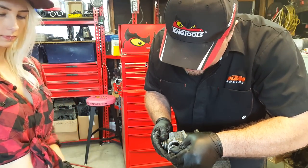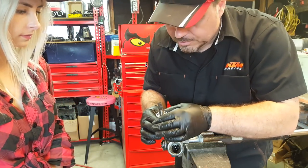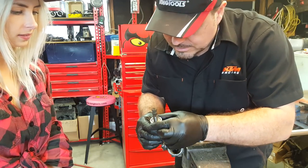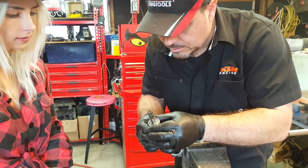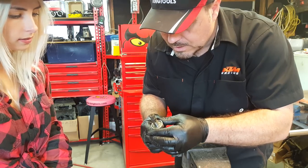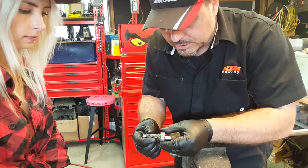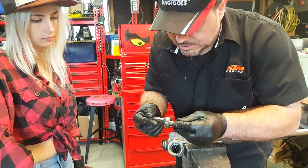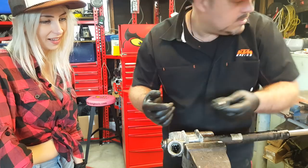So we'll have a little look. Oh no, I was wrong. It's a normal bearing. Okay. All right. Hey, I'm not always right. Oh, geez, look at that. Greasy. And how worn is that? Look, see there's loads of movement on it? Yeah. So that bearing is completely shot. It shouldn't be like that. Okay, yeah, it's greasy. So I'll see if I can clean up, have a look.